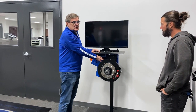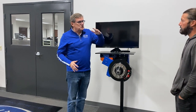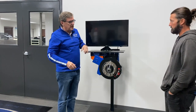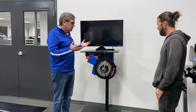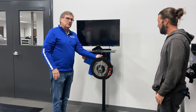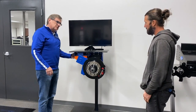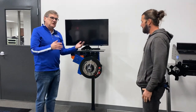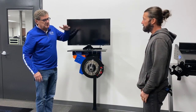There's also a heavy-duty hydraulic shock absorber. Think about tires like a basketball — when you bounce a ball you get a lot of residual energy and bounce. Same with the tire: you get bounce and chatter. The shock absorber pulls up and then pulls down hard so the tire is not bouncing. The rubber frees it up, and the shock absorber pulls it down hard. The rest is just mechanics — a giant beam assembly acts as a lever arm that moves up and down in response to the wheels hitting bumps. There's also a journal bar for lubrication with Teflon bearings. Each wheel responds individually to the road, with rubber absorbing shock and the shock absorber keeping the tire from bouncing.